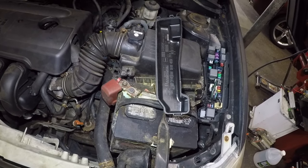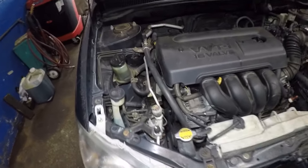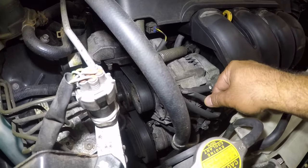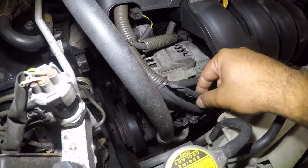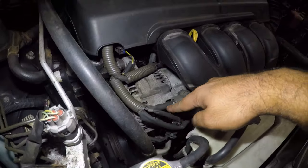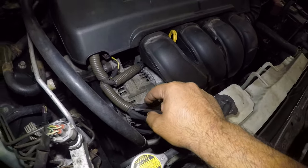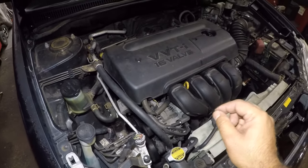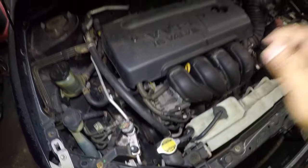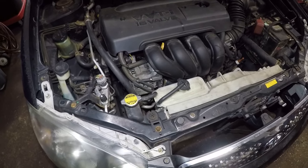Also, I want to mention one more thing. Right over here, you have one wire coming up. You see this wire? You can even take your test light. This wire is coming from the AC compressor — it's one single wire. You can rip this open a little bit, back probe that wire. See if your AC compressor is getting power. If you take your test light, put it to the ground on the battery and put the test light here, and you put the AC on and your test light illuminates, it's probably your AC compressor that's bad.